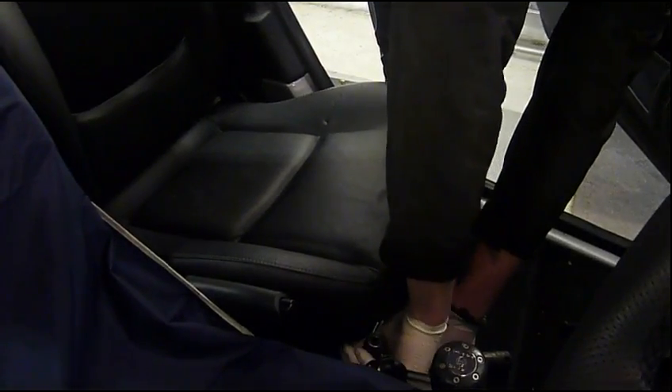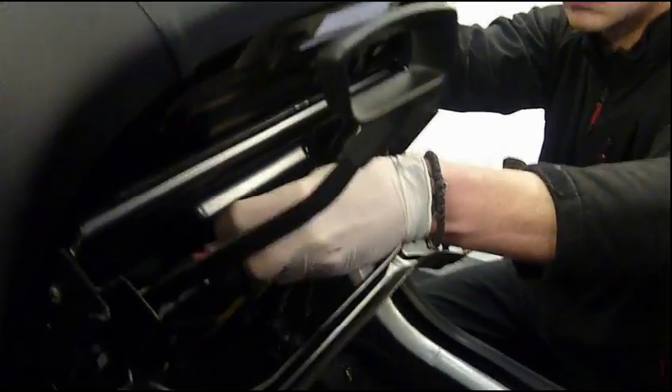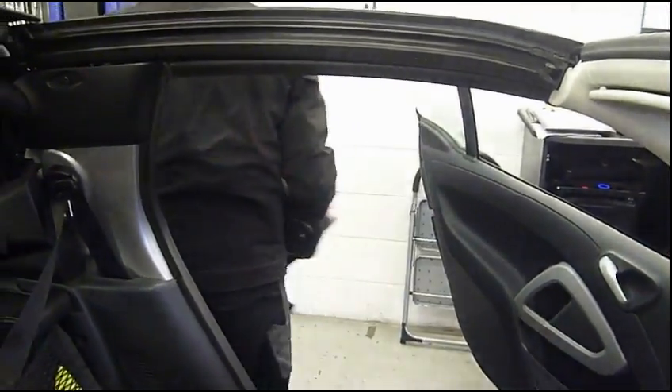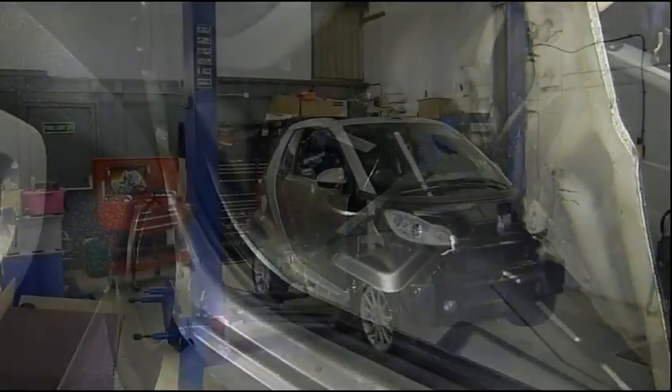As this is our demo vehicle, we are going to install the vacuum pump under the passenger seat for ease of access. Ensure the vehicle battery is disconnected before unplugging any connections. Remove the polystyrene foot pad battery cover from under the carpet in the passenger footwell area.